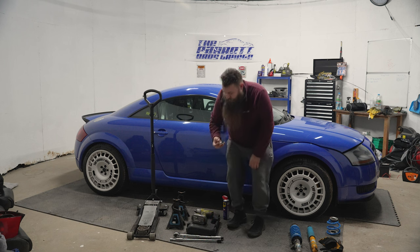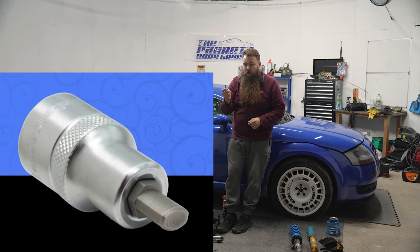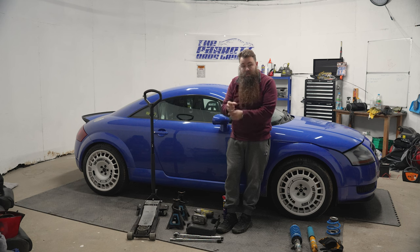The tool I recommend for everyone — you can get these on Amazon, eBay, probably your local motor spares shop — is this little bad boy. This is a VAG suspension tool. It has like an oval shape, and what you do is you put it into the back of the front suspension hub, turn it 90 degrees, and all it does is allow the hub to open just enough so the shock drops out and literally falls out. I'll show you a video of it when I do mine. Honestly, the amount of times I used to spend with a 12-pound hammer, just beating on the top of the hub — we're talking 15 years ago on all manners of old cars, it was seized solid. And this thing, honestly, with a bit of spray, that twisted and it just falls out.